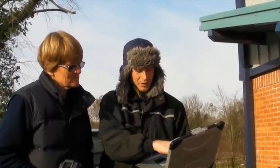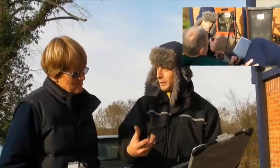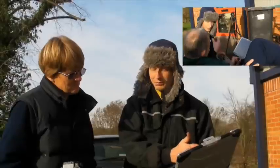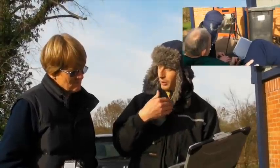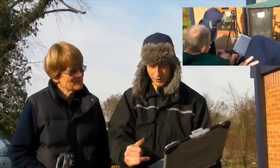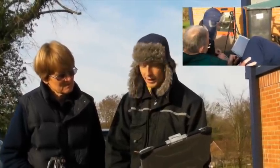The torque sensor value, so the amount of pressure you've got to put through the cranks, I've turned right down as well. Also the delay, so from the point where it's receiving all the relevant information to actually give you the assistance, I've made much faster to react as well. I've put the turn off delay so he should get assistance a little bit longer past stopping pedalling, and the other two there won't really have too much of an effect on how we're trying to set the motor up here today.